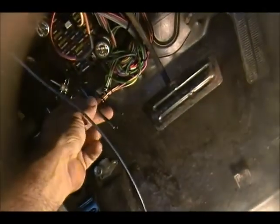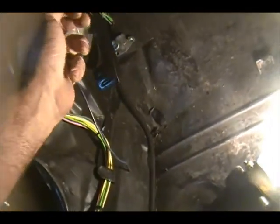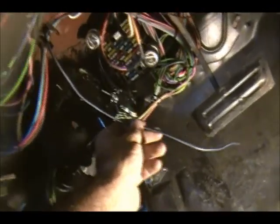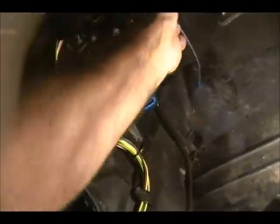Now we're going to wire the... I gotta make a pigtail. I gotta make an extension, actually. This here is the ground. So this has to be grounded to the switch. I gotta make a pigtail here, and then I have to extend these out to the switch, and this is power in. So this power is going to essentially become friends with this one. That will be power into the pump, into the motor. And then these have to come out.